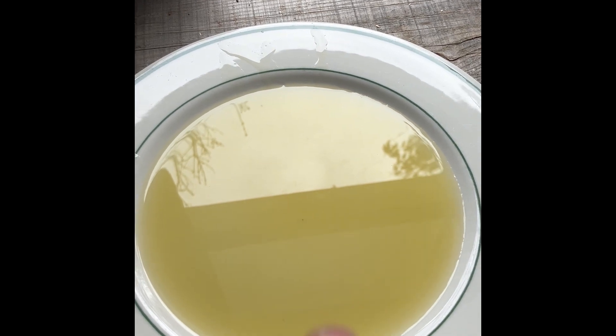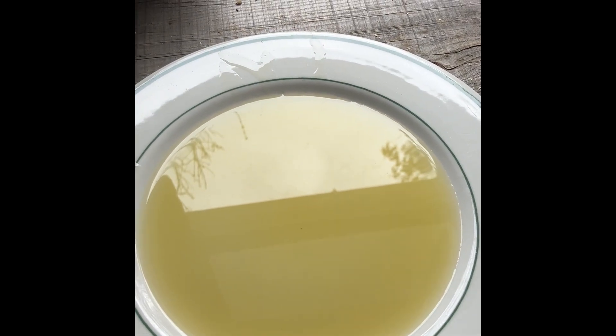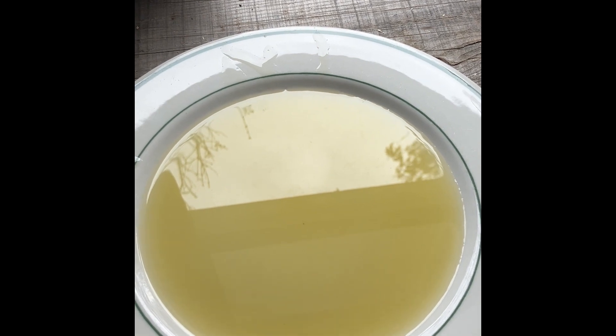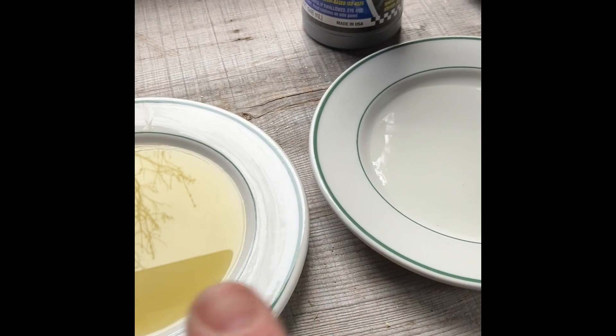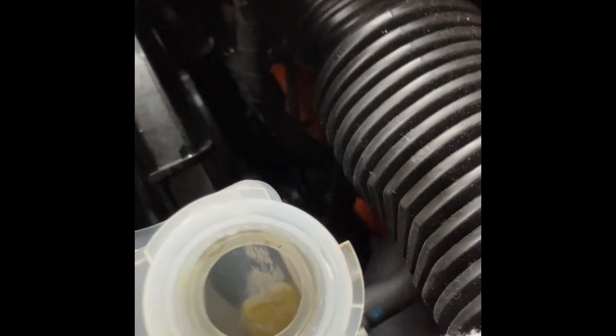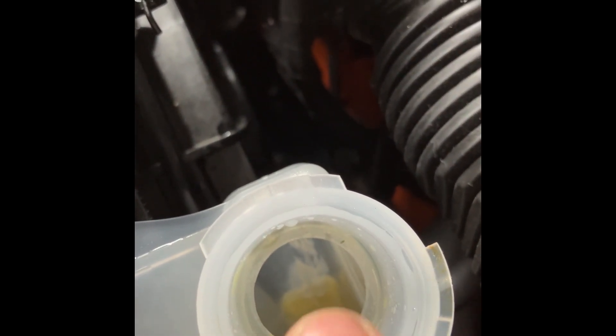It's quite cloudy. I don't know if that's DOT 4 fluid or 3 — I couldn't find that in the manual; it can take either as a basic hydraulic fluid. But what's more interesting now is: yes, there is indeed sediment at the bottom of my reservoir. It looks all white and a little chalky. We'll take a closer look before I clean it.